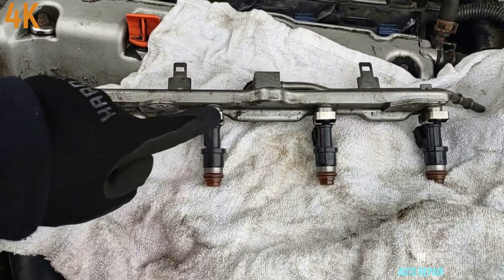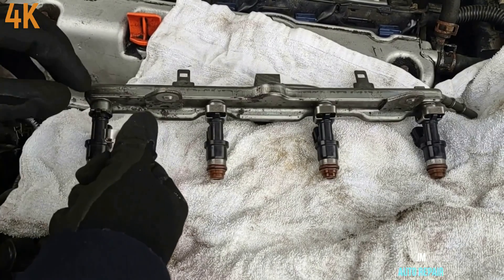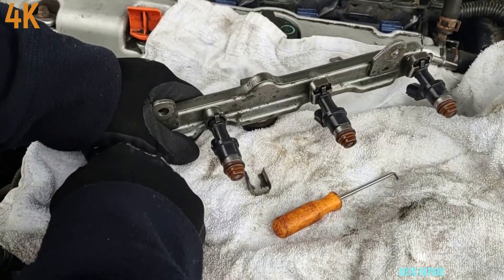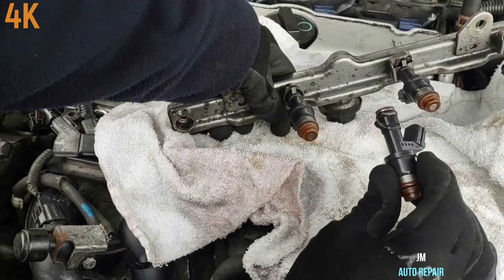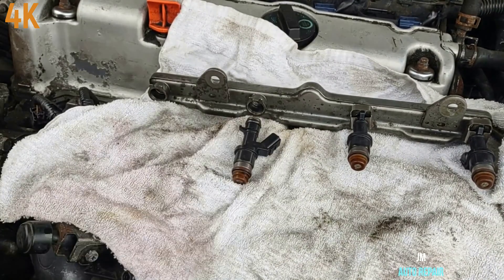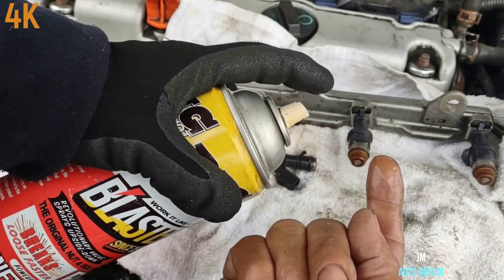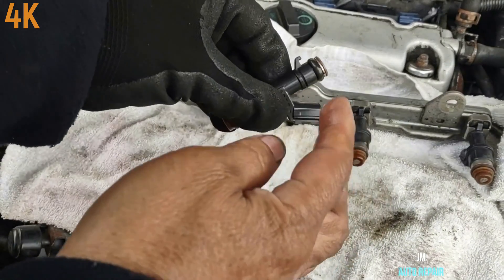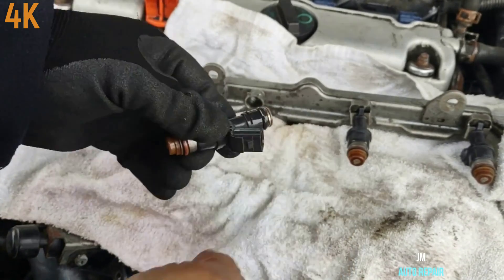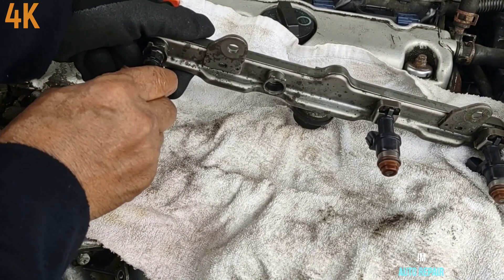A fuel rail — there's a lock here for each injector. I'm gonna use this 99-cent tool. Just look at the position that it is — it goes only one way. You don't have to pull it straight. Once you take this out, you have to visually inspect it. Also you can clean them. Do not put your finger here — carefully, just lubricate the O-ring here. The reason is so you don't take the chance of binding it, and it goes inside easily.